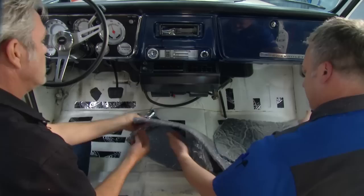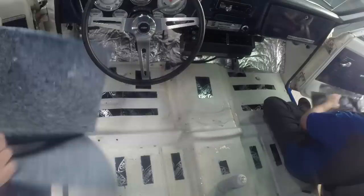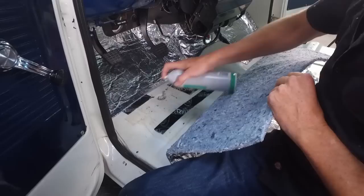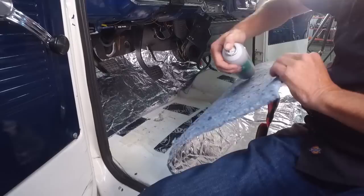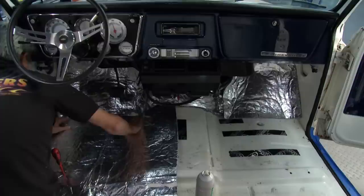On to the next step — the heat shielding insulation. Once again, there's a diagram from Brothers Trucks. There are hole guides on it as well so you can get a general idea of where the holes are going to be needed. We looked at the diagram, got everything dry fit and laid out. You're only going to have one shot at this — if you glue it down and try to pull it up, it's just a bloody mess. Pull part of it back, put glue on the metal and on the insulation, then use your hand to roll it down. Take your time — if you're going fast, you might cut your thumb.